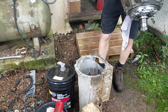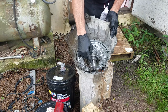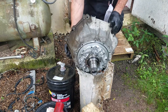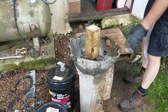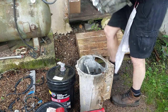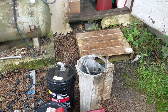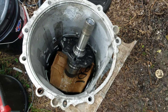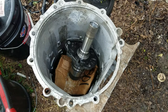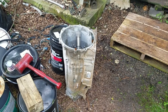6L80 — well, it's a 6L90 case. That was no good. I need to remove the stator support. So you take the bolts out of the stator support, you stick it down in this case, and — hang on — there's a cardboard box in there that catches it. Could it be any easier? So don't throw away at least one 6L80 or 6L90 case because it could come in handy.